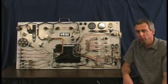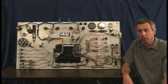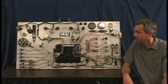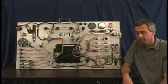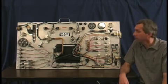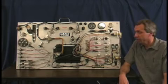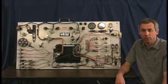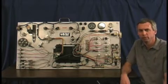I built this board for two primary reasons. Number one, it's a great recruitment tool. I take it to various high schools and other shows and it draws a lot of interest. Number two, I use it as a training aid in my own lab with my own students. I'll sit this thing down on a table with a student in front of it and have them chase down a fault code or some other error, or maybe do some programming or recalibrating a speedometer. I found that this device is a nice bridge between classroom theory and actually having them work on a real truck, because all of the components are right there on a two foot by four foot board.